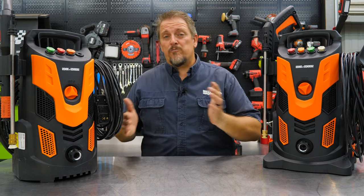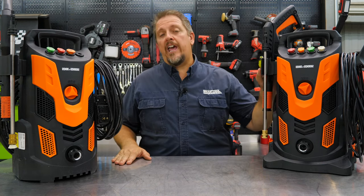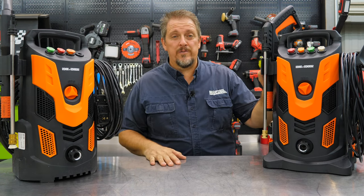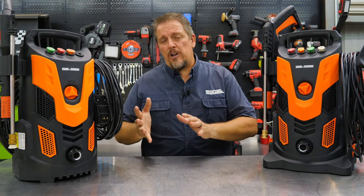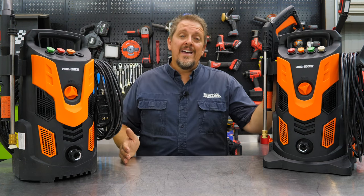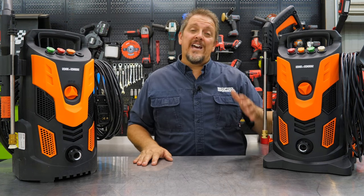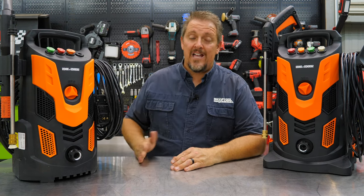So is it going to run for small jobs? Maybe it will, maybe it won't. Here's the point: this is a $150 unit. We proved there's no way it's putting out 2.5 GPM — we measured around 1.86 GPM, which is close to their rated 2.0 GPM claim, so they're close on that. Is it hitting 3,000 PSI? I doubt it. They claim 2,300 working PSI, and as we showed, it takes about a 6-horsepower gas engine to reach those numbers. At 1,800 watts we're somewhere around 2 to 2.5 horsepower.